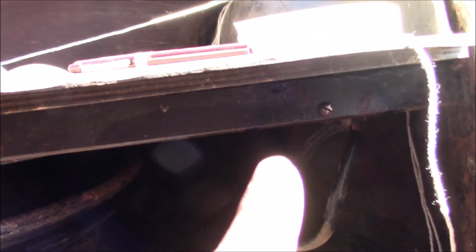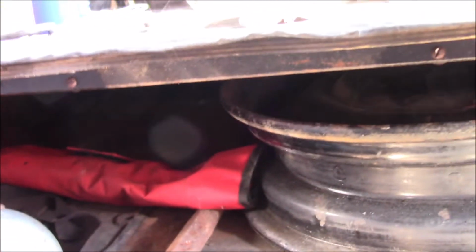the wiring for the brake lights actually runs across this strengthening bar here. This basically supports the upper deck of the boot lid, the upper deck of the boot floor even. And there's a series of flathead screws which hold clips that hold the wire in. They seem just a little bit too tight for me to pull the wire through. So I've got those soaking in some penetrating fluid for now, and when that's been soaking a while I'll have another go at them and remove that. So the only wiring left to go now is that section.